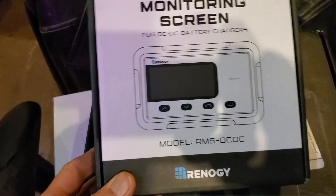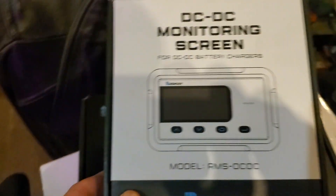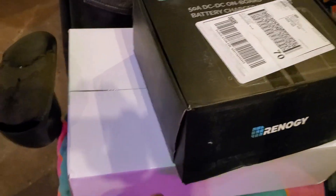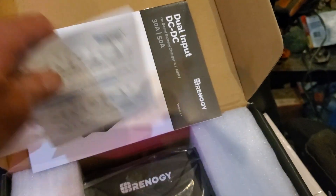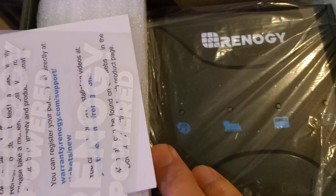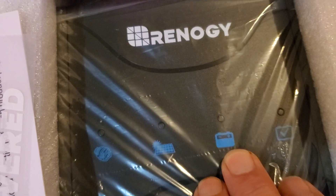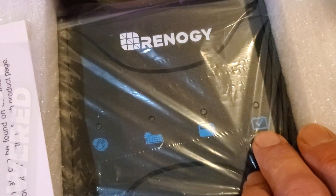This is my monitoring screen - everything I got is from Renogy. Here are the model numbers. That's the control screen. I've got the 50-amp DC-DC charger charge controller. The nice thing about this one is it's a dual-input 50-amp MPPT. You can actually connect it to your house batteries or your starting batteries and it'll draw 25 amps from your alternator when you're running and charge your house batteries. It also handles the solar panels - that's output to your house bank - and it has a starting battery tender, so when you're on solar it'll top up your starting batteries.